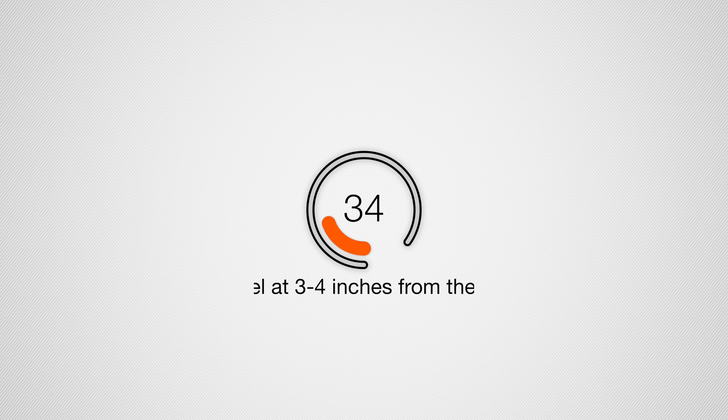There was actually a user over on the other video who had asked me about the noise — is it obnoxious? So really briefly, let me run through the decibel levels. When the card is actually running idle, it will run at about 34 decibels. But when we're actually asking something of that graphics card, when we're doing something graphics intensive, that thing starts to ramp up and it sounds a little bit like a jet engine. On the low end I got 49 decibels, but I was getting a peak of around 60 decibels.